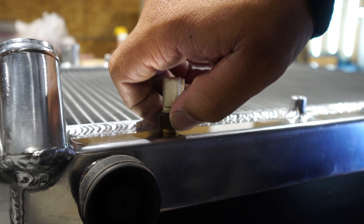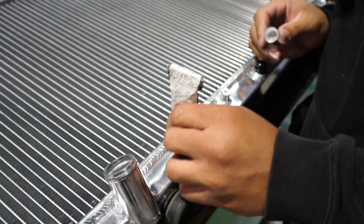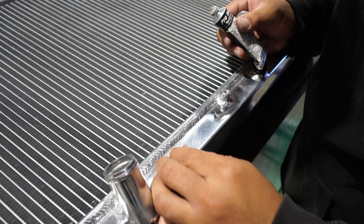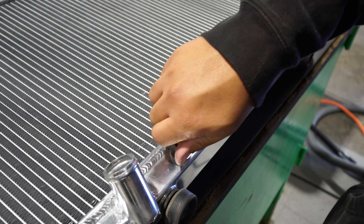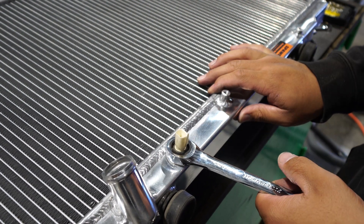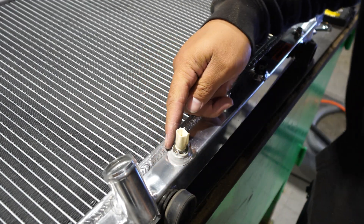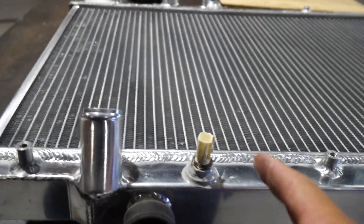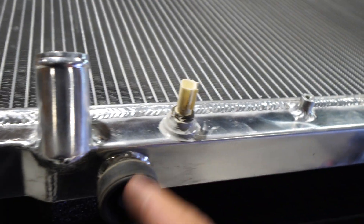When we get to the bottom right here, you guys can see that gap still — Honda Bond High Temp Gasket Maker. We're just going to sit back and hope that doesn't leak — it's the best idea I came up with. I'm not sure if that was the best spot to tap; I feel like the metal's a little thin, I only had about two to three threads of engagement. It went on pretty tight though, and we've got the high temp gasket maker around it.